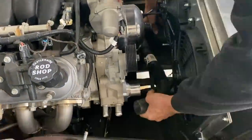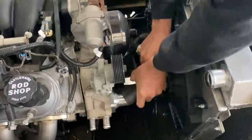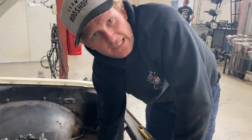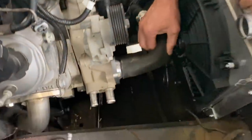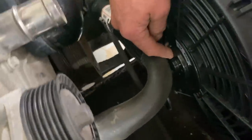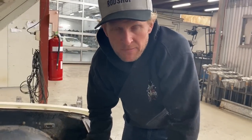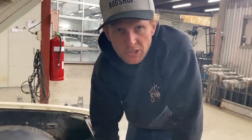Try it again. Looking at the hose, we are kinked. If you go down close it's going to be pretty flat, and we're touching the thermo fan. We've still got a fair bit of room though. What I'm going to do — Chevy will probably throw it in fast forward — I'll keep cutting increments of the hose off, say 20mm at a time, until hopefully we get it to fit. Just slowly work your way back.